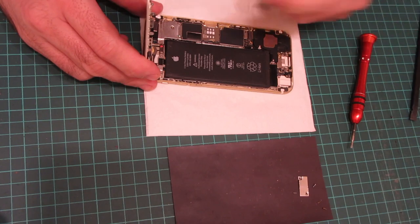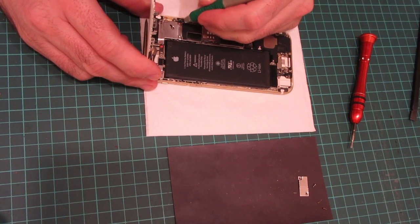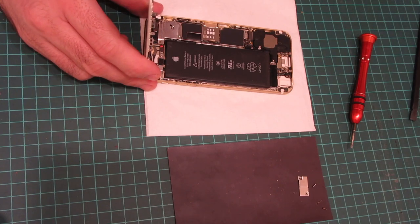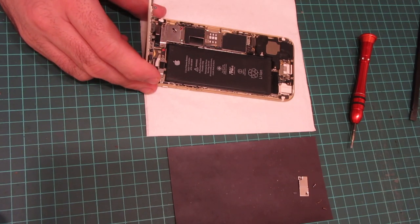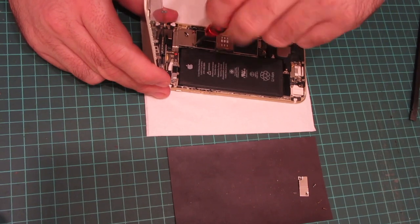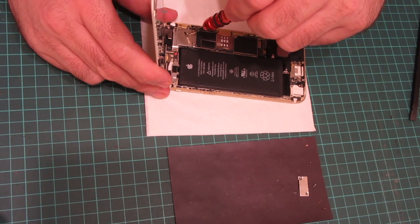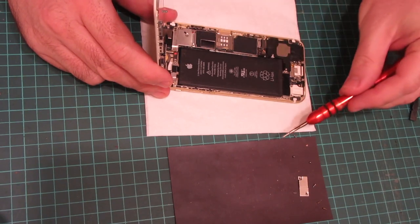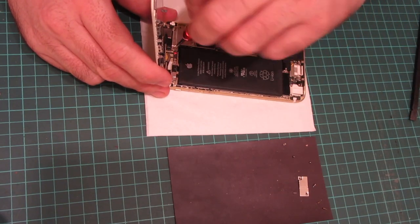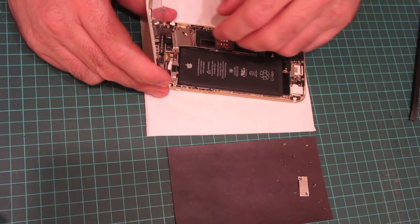I really hate it when people drop water-damaged phones off to me and don't tell me the water damage is actually toilet damage. Now, I know it's a bit silly, but I do like to colour-mark all the screw heads. The last thing I want to do is get long screw damage — just in case I accidentally knock the screws off the pad. It's just being pedantic, covering my ass, things like that. Better to take five seconds to do that than to stuff it up and be down quite a lot of money.